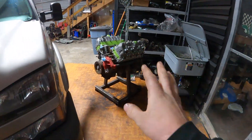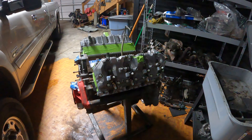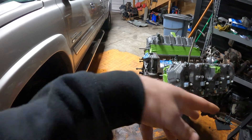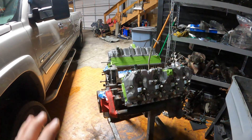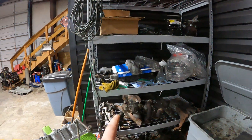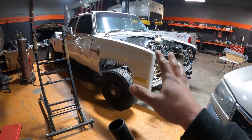We've been putting this LLY together — got everything cleaned up. We didn't do anything really with the bottom end, changed the pins on the cam and crank. It's basically a stock build with 30-over injectors, a Sportsman's pump, new water pump, front main, rear main, oil pans, and a Wagler pinned oil pump. It's getting Ryan's Diesel Service 64/66 mil turbo. We're waiting on a replacement intake runner — one came in cracked. Once we get the up-pipes and turbo on, it'll be ready to drop in.